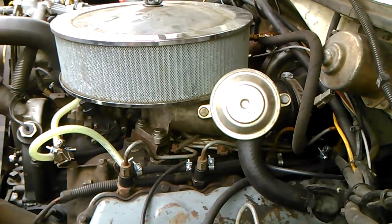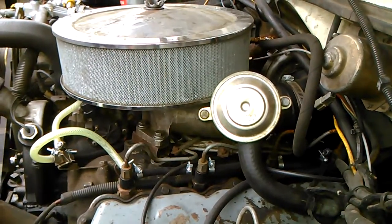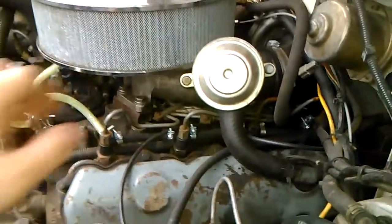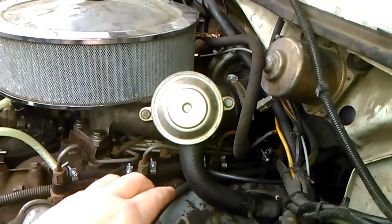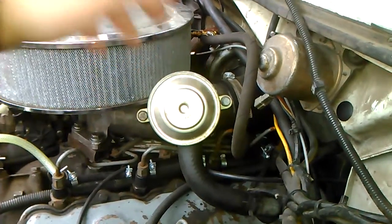or this one's a naturally aspirated motor with the aftermarket turbocharger kit — the Hypermax kit — but also on the factory turbo trucks, they typically are mounted on the intake tube or the intake box and are vented from the valve cover. On the naturally aspirated motors, they're normally mounted in the very back, behind the intake manifold, and going down into the valley pan.